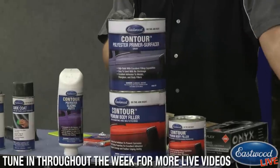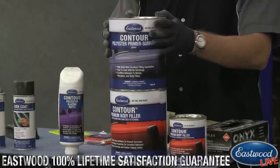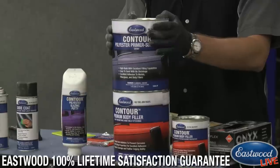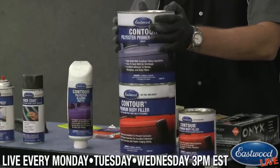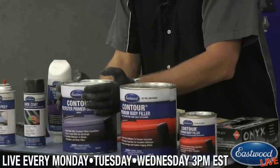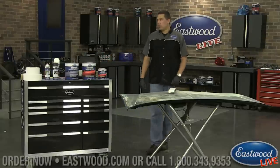So you can spray the entire hood, and then it allows you to block sand that hood super smooth, getting rid of all those crazy sand scratches that may be in there. Even if you're at 80 grit, you can do it. I tend to like to do around 120 with this, but this is a super building primer that is absolutely excellent for getting those nice laser straight panels. So at this point, we've covered a lot of the body work. We'll jump back over to Randy and see where we're at.